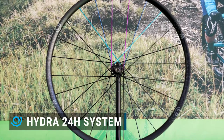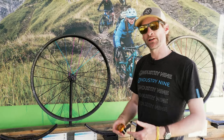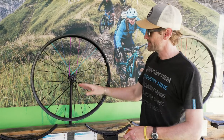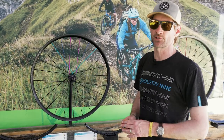Next in our Hydra chassis lineup is our Hydra 24-hole system chassis. This is going to be more toward trail riders and XC riders. We're using a 24-spoke configuration laid out in a two-to-one arrangement — 16 spokes on one side, eight on the other. That's 16 spokes on the disc side front and 16 spokes on the drive side rear. The two-to-one creates a really balanced spoke tension for a lighter weight application. Twenty-four spokes in that two-to-one is a really clever arrangement, and this is also using our Hydra drive mechanism with 690 points of engagement.